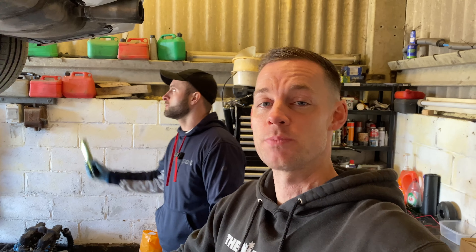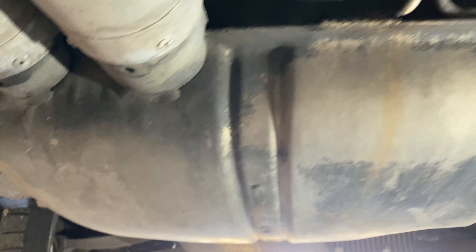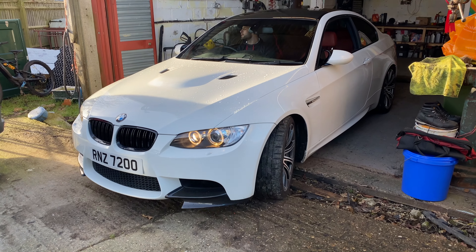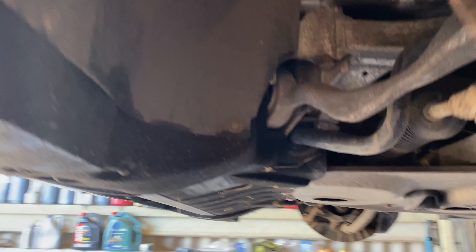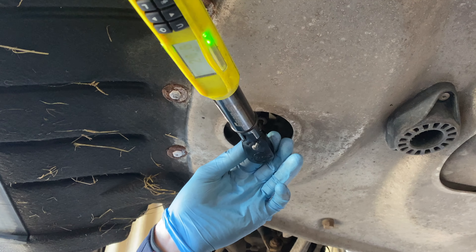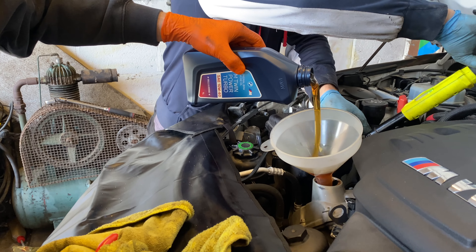While the oil drains, we went around the car to check for modifications. Me and Tor can see the exhaust has been modified - you can see some welds on the top where someone's done an exhaust mod on the standard exhaust, giving it that more throaty sound. Very happy with that - a neat modification. We also spotted lowering springs on the rear and the front. The sump plugs went back in with the drill and torqued to 25 Newton-meters, then fresh 10W-60 genuine BMW oil was poured in.